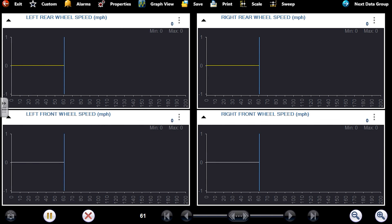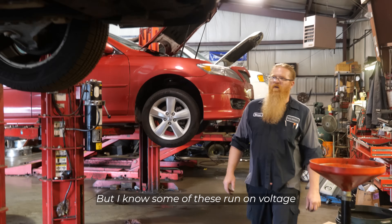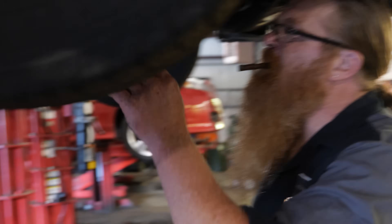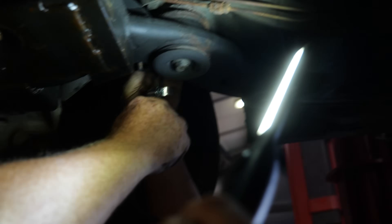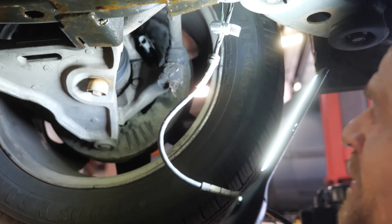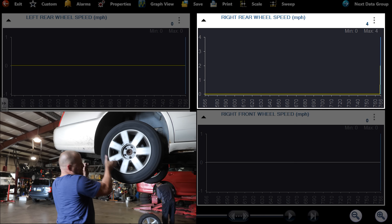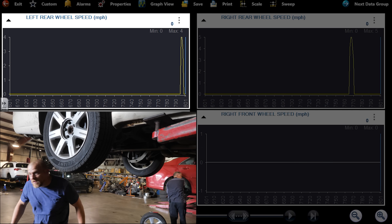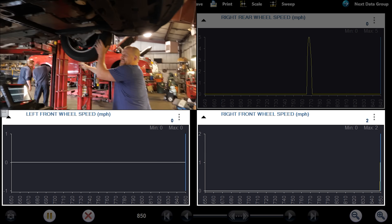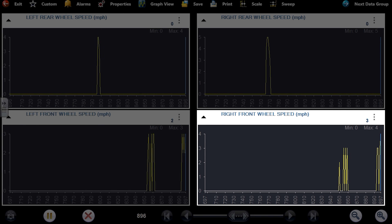Let's pull up our data — just interested in my wheel speed sensors. Did you have this unplugged, Danner? He unplugged it and started looking at it. I know some of these run on voltage and you can see about two volts either way. We fixed it up here — right here there was a broken wire. You have this unplugged; let me plug this back in. Right now they are both functional — it's making a signal. He didn't say it was intermittent.